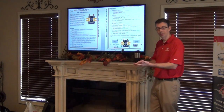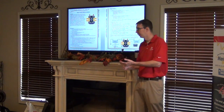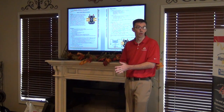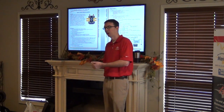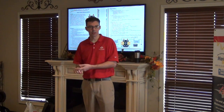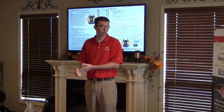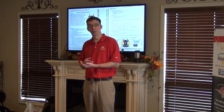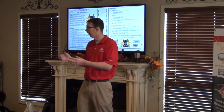This solenoid is automatic and what it's looking for is voltage — it's all voltage-based. It has to see a drop below 12.6 volts on the house batteries and maintain 13.2 volts on the chassis batteries. So as long as we're driving, we have more than 13.2 volts on the chassis. Once the house batteries drop below 12.6, the solenoid will engage and start charging the house batteries from the chassis.